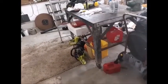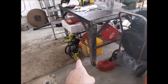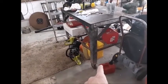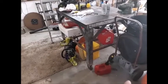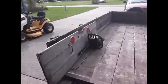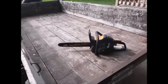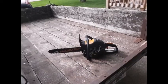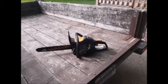I suppose I better go out and start that McCulloch, so when I go back to working on that one in this series - do I call it Michigan Chainsaw Massacre part number... I don't know. With these cheaper home-grade saws, I don't know from new what they would sound like, how responsive they are and things like that. It's not very responsive and I have adjusted the high and low screws and got it about as best as I can get it.